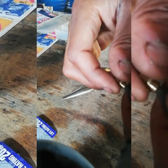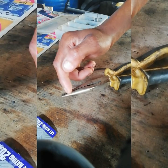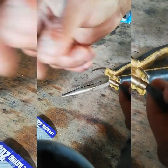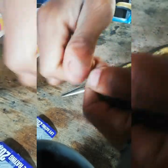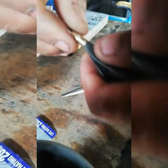Polish that needle too. I recommend keeping it at — your needle has levels. From the bottom, the first needle adjustment, count one, two, three — put it on the third one and try it. Keep moving it up and down through the spaces until you find the one that's satisfying for you. You want that inside nice and clean. You can do the sides if you like, though there's no real need — I'm just doing it to be extra cautious.